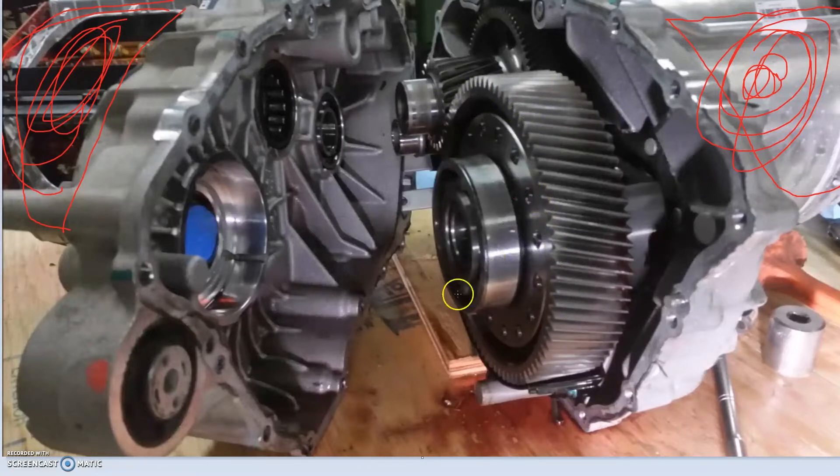The stock Tesla uses hydraulic rear calipers and an independent pair of electromechanical handbrake calipers — like a lot of modern cars with a little electric actuator that pulls the handbrake. In the Donut Media video they said they're using a hydraulic setup for the handbrake, so I assume it'll have independent calipers for handbrake and foot brake. When you pull the handbrake, the motor controller will cut power, the wheels will stop the drive shafts, the drive shafts will stop the diff, the diff will stop the intermediate gear, and the intermediate gear will stop the motor. The entire driveline comes to a stop.